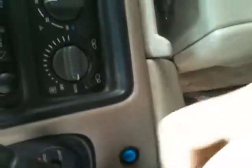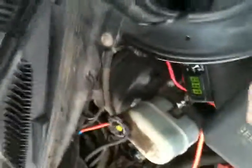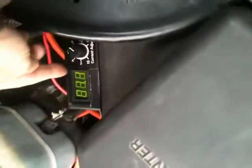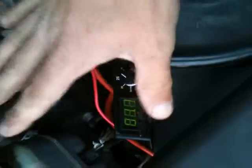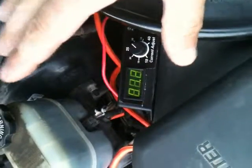Anyhow, as you can see, the switch is off right now. Okay? There's no light on it. I start the vehicle up, it's still off. Okay? With it off, we go up here and we look. You'll see I have a small amount of amperage here, about 1 amp. That's because the power that I'm drawing off from the fuel injectors is running into here. Okay, because remember we tied it in right there, so it is running into here. So it is getting a small amount of power. It's actually about 5. I believe it's about 5 volts is all it's getting.